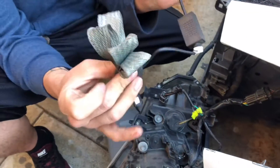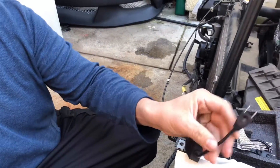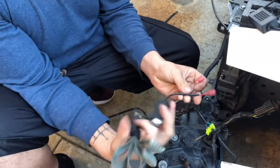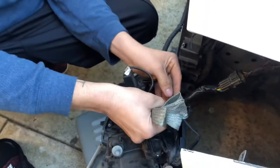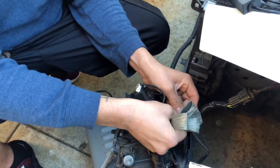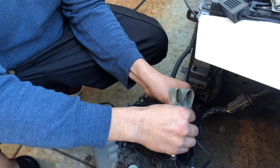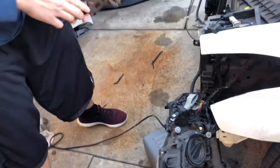This is my old one — you're going to have to cut this end off and then add these connections to it so it can be a plug-and-play type of thing. So black with black connects right there, and then the red with the green connects right there, and that should turn on. I'm going to turn on the headlights and this should clip right onto this.